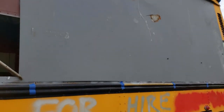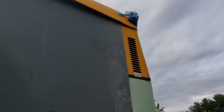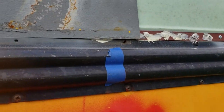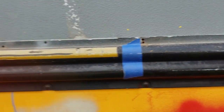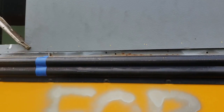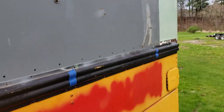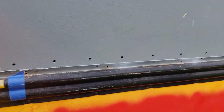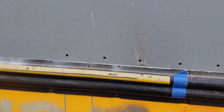Okay, so the kids and I were on the second attempt successful here at getting this up into place. It was catching up in that corner a little bit. I had to kind of spread some metal out that was kind of getting in the way, but anyway, we got it in place. I put the little yellow paint dots all along the bottom for the bottom track of rivets. So I'm going to drill those holes, and then I'm going to caulk and run a row of rivets across the bottom. Okay, I'm about halfway through or so, maybe 2/3 with the bottom here, drilling the holes, and it hasn't taken too long with the sharp bit. Can never have too many sharp bits.